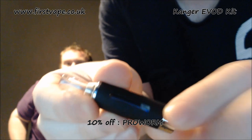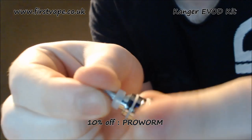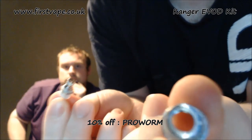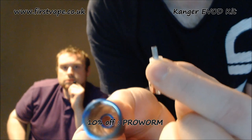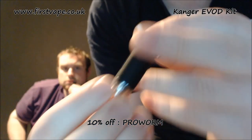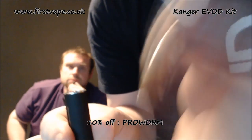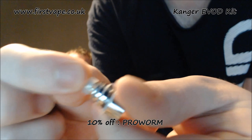Shall we show people how to remove an atomizer head? We're going to tell you this just to make sure — always screw your Evod off of your battery first. We've got your Evod there — literally just unscrew the base. We'll put the top aside for a minute. This is your actual atomizer head. Just screw that out of your device, then pop your new one in and screw it back on if this burns out. Because these are bottom-filled, if the coil blows midway with juice still in it, hold it upside down — it's got a nice flat surface on the lid so you can stand it up. Take this off, put your new head in, put it back together, and you don't have to waste any e-juice.